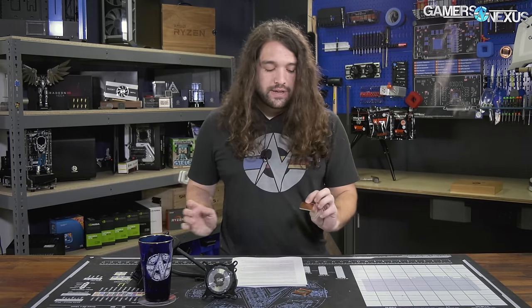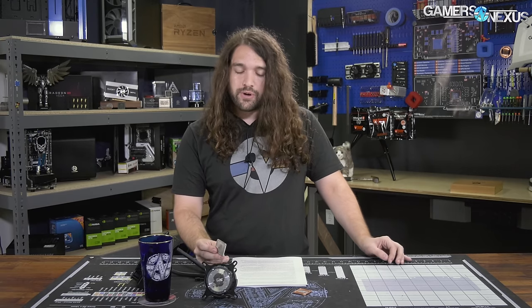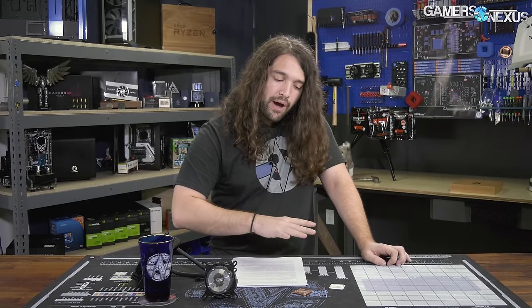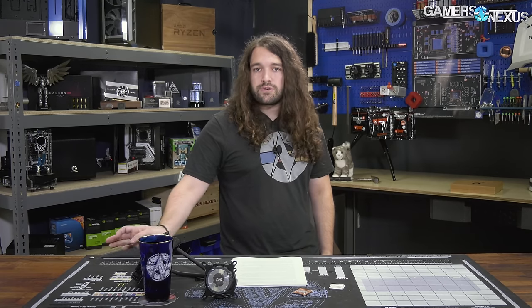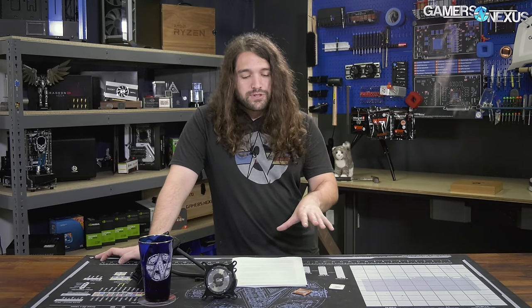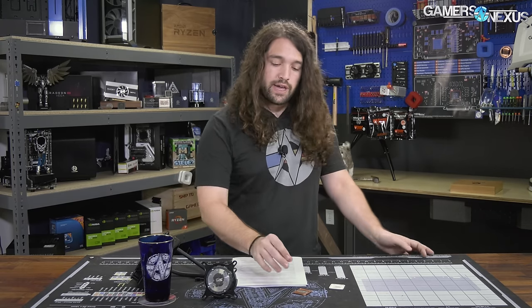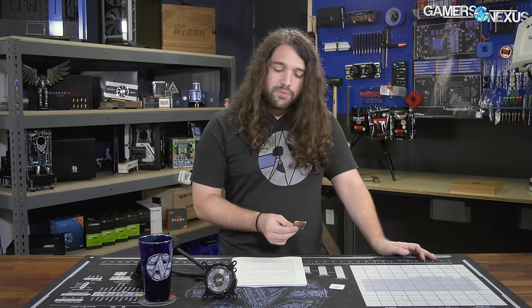With nickel-plated heat spreaders like this one — basically every heat spreader on the market currently — you have nothing to worry about. It will stain, so if you put it on top of the heat spreader, you might not be able to see the Intel or AMD branding after cleaning it off. Most of that staining is removable with acetone, but some of it will probably stay somewhat permanently, especially through more aging and thermal cycles. Don't worry about it from a performance or chemical standpoint — it's fine with Conductanaut, Cool Labs, and the other liquid metals we've tested.